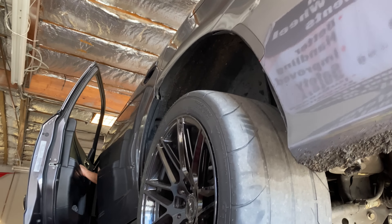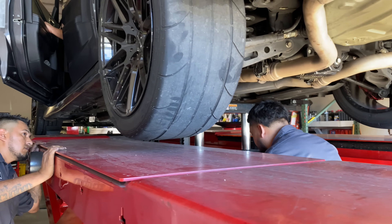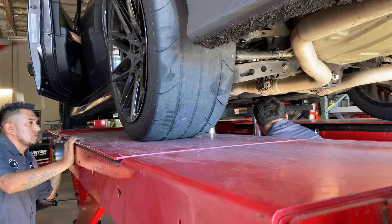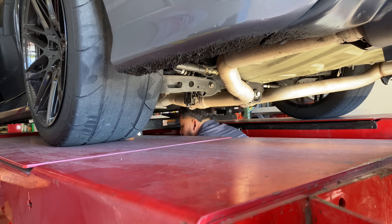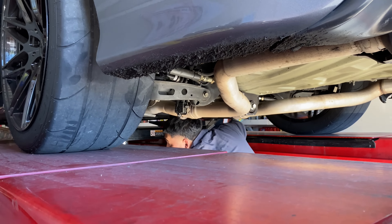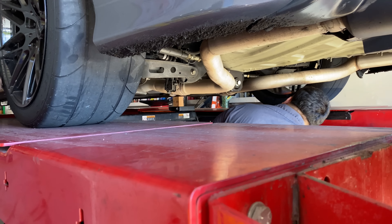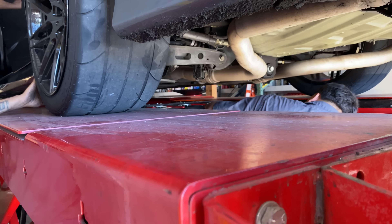The back is lifted, that makes sense. I almost noticed it more with more people in the car, so with more weight in the car there was more vibration. It really feels like it's in the rear or the middle of the car - that's why I think it's either the axles or the drive shaft. New tires? No, because the vibration only happens when I'm on the gas at low RPMs on the freeway. It doesn't happen any other time - any other time it's just smooth as hell.